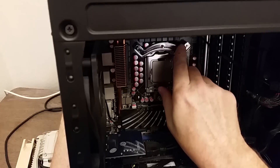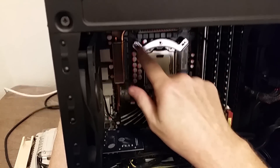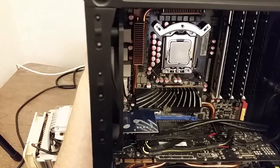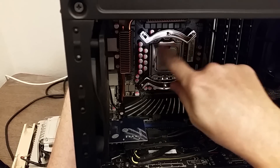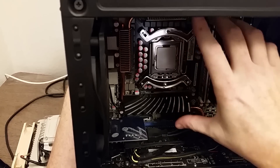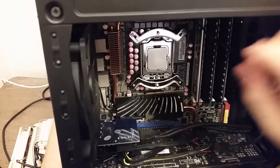For orientation A with it blowing toward the back, I'm putting the bars across the top, and I'm putting them through the outermost holes, which is for socket 1366. There's also a notice in the manual to make sure when you're putting these on that the curved part goes toward the outside — if you put it the other way, it won't align properly.